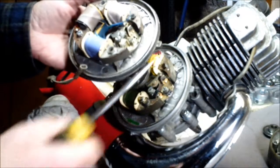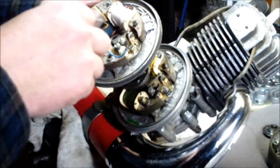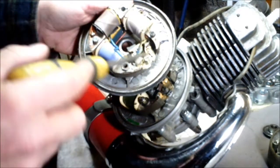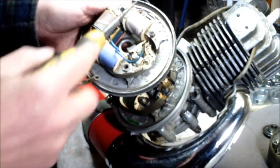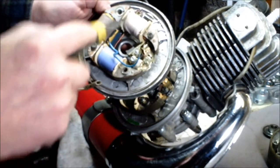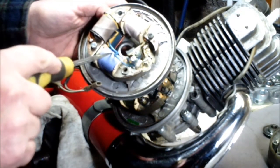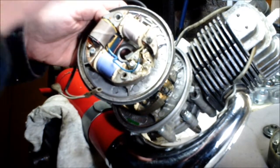Now the business side of it. This blue wire that's just kind of dangling — that comes out of the condenser. That's our condenser wire. That is just loose because I don't hook up that condenser — I use an external condenser. This gray coil on top here, its only purpose is to energize that 6 volt. This blue coil at the bottom, its only purpose in life is to generate your 12 volt accessory.